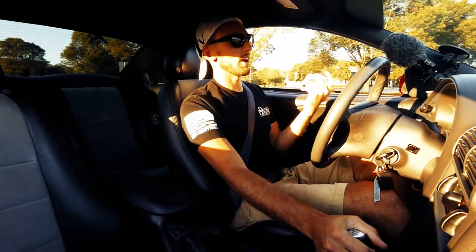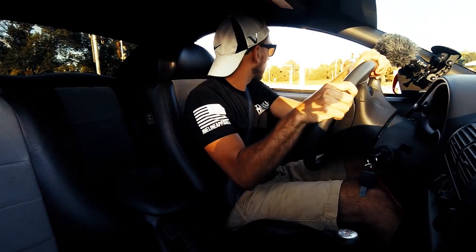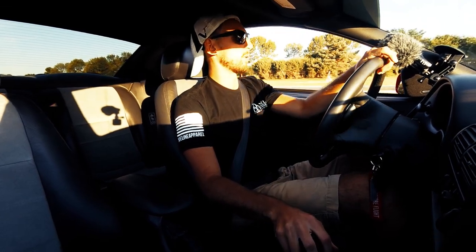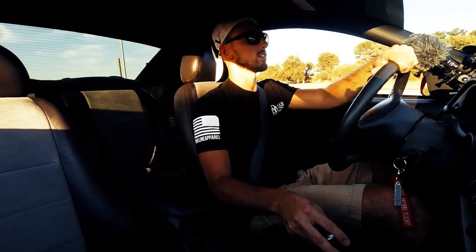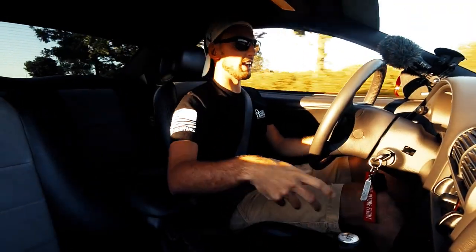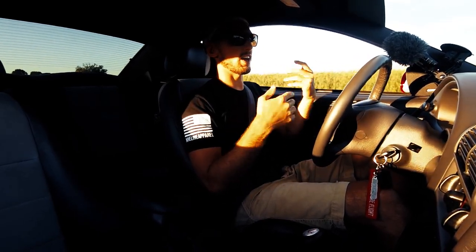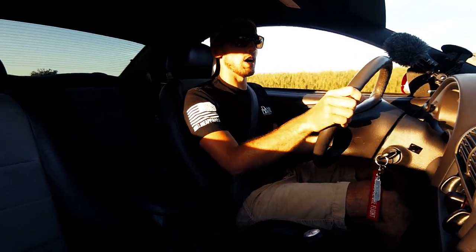The trade-offs are super light pedal pressure and a high horsepower rating, so you can obviously hold a lot of horsepower and shift very quickly. I really like the bushings I did in the car, but probably my second favorite has to be changing the clutch because it just makes it easier to drive. Before it was kind of a chore because the clutch was so heavy. It's really not an on-off switch either, which is nice — you can ride it a little more and not be jerky at all.